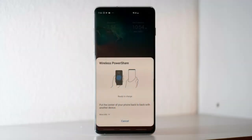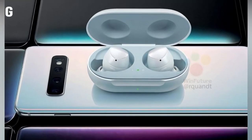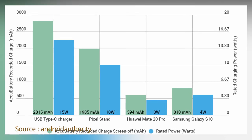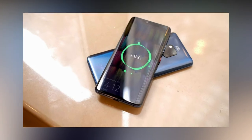The new Samsung Galaxy S10 joins Huawei in offering reverse wireless charging capabilities to power up other gadgets on the go. To enable this feature, a quick toggle is available in the settings menu, and you are ready to charge up a Galaxy Watch, Galaxy Buds, and any other Qi-certified device — that includes other smartphones. Once enabled, users need to quickly place the other device that needs to be charged on the backside of the reverse wireless charging-supported device. Otherwise, this feature will turn off automatically in a few seconds to prevent power wastage. The Samsung Galaxy S10's wireless power share is capable of providing between 3.5W to 4W of power, while the Huawei Mate 20 Pro offers between 2.5W to 3W. However, both are substantially slower than regular wireless charging.